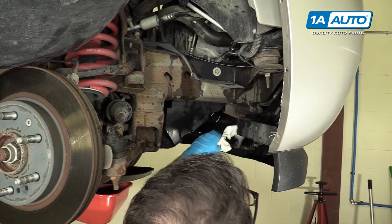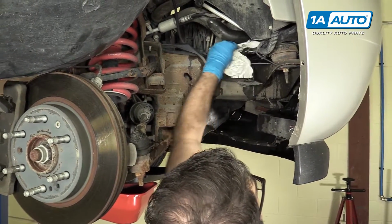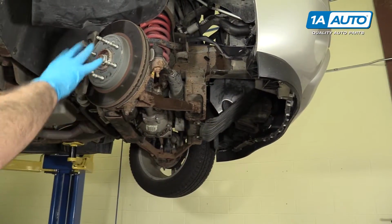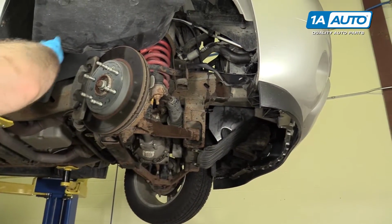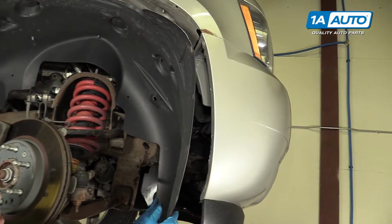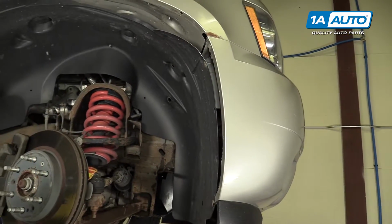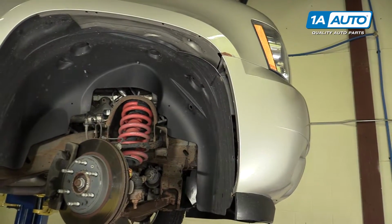So after you put the hose back on, just take some paper towels and dry it up as best you can. And then when you're all finished with the project, you can take a hose and some soapy water and just kind of spray it down to get rid of all the residue of the coolant. All right, so we're just gonna put this back here for now so it's out of the way. But we're gonna go up top and work on the coolant expansion tank or reservoir.